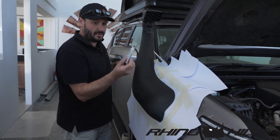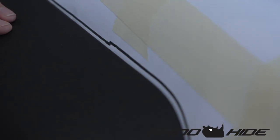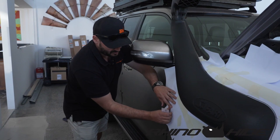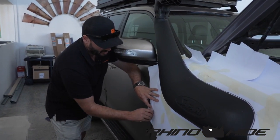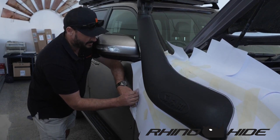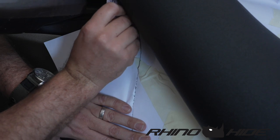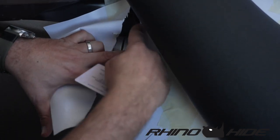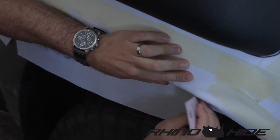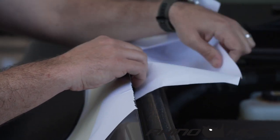We've reinforced it with a little bit of extra masking tape. Now just get a whiteboard marker — so if it does touch the paint underneath it's not going to permanently mark it — and give myself a couple of millimetres margin. What we want to define here is the extent of where this panel is, and the best way to do it is to just run your finger down the crease line with something like a credit card and you can pretty much slice bang up against that line. This gives you the defining edge of where that panel starts, and if you use something like a credit card or ID it's not going to scratch your paint underneath, so we can follow that edge right up. See, that's that line right there — just going to get that crease line and define the edge.